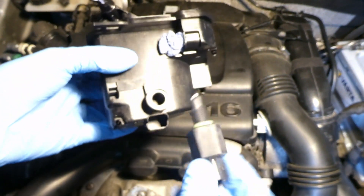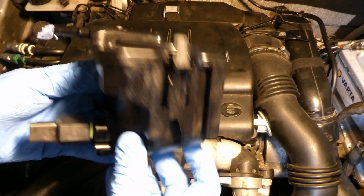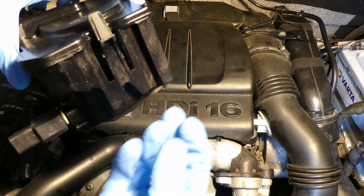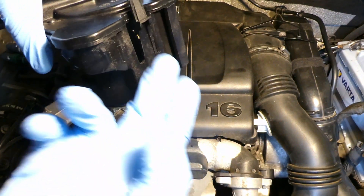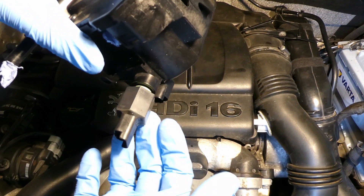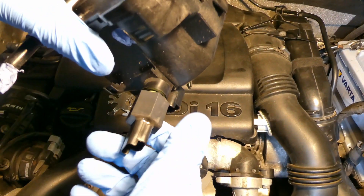After about five minutes there's a perfect separation between the water at the bottom and the diesel at the top. So the water-in-diesel sensor screws in at the bottom, because the filter is oriented with the bottom down. If you have condensation or water in your fuel tank, the water goes to the bottom. The sensor measures the difference in resistance between water and diesel.